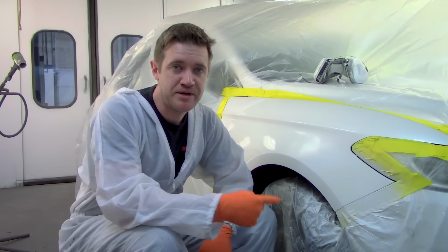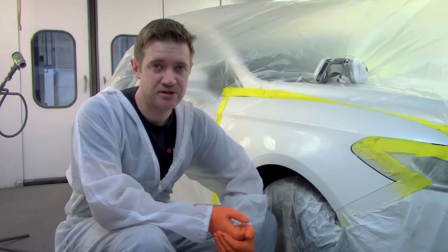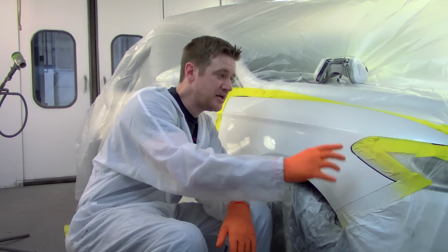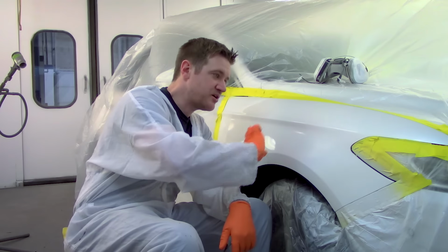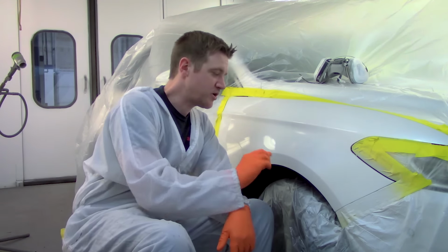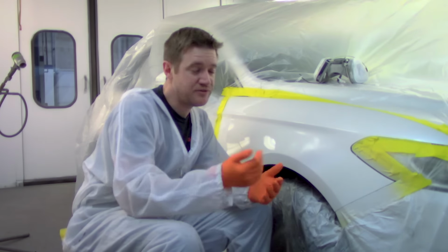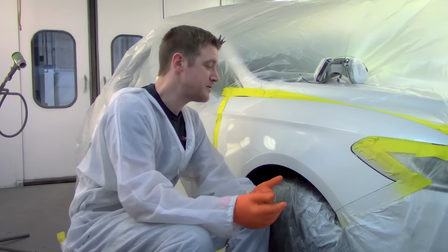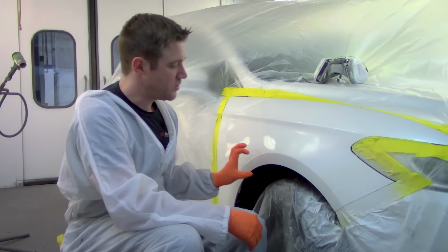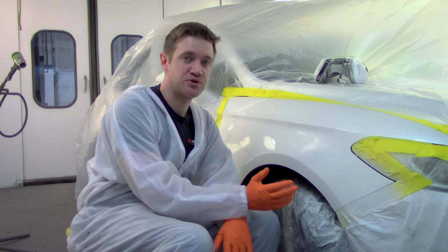All right, we've got our mid coat on here now. So what we're going to do is let that flash off for about 10 minutes and then we're going to hit it with the clear coat. So what we want to do is get one good wet coat over top of the base, and then we want to keep it again within our 1500 sand scratches. Our second coat, we're going to try and taper it off, and we're going to try and have a little bit of dry spray so it sort of gradually fades in, sort of like what we're doing with our blend, but we want to try and keep it a little bit smaller. And then we're going to melt that edge away with the blending solvent. So that's where the clear is going to transition. So the clear has to cover all of our base coat first or else it's not going to work.